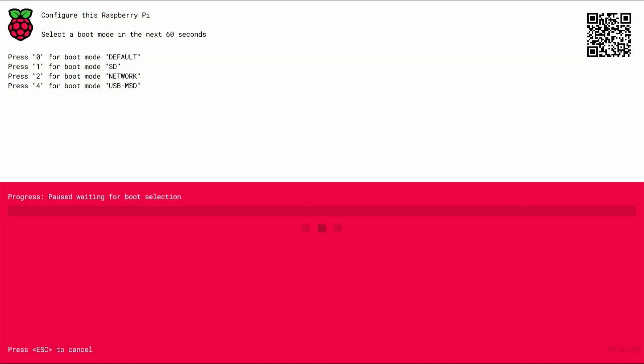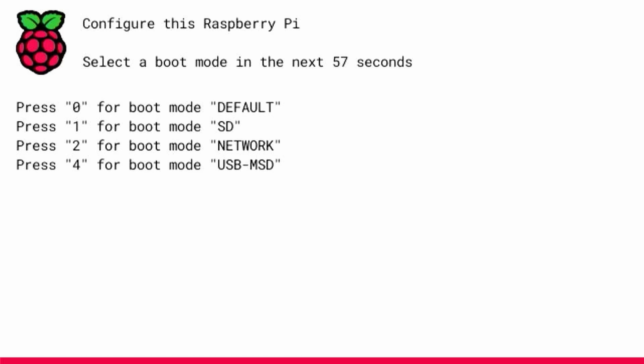Then, of course, you need to reboot, because this is a menu that comes up during the boot process. When it's booting up, press and keep hold of the space bar. If you do that, a new menu will come up that allows you to pick where you want to boot from — including booting from the network, from an NVMe drive, and so on. A boot menu, just like a PC — a really convenient way to choose which media you boot from during that boot-up process.